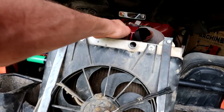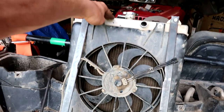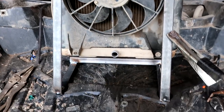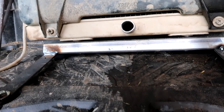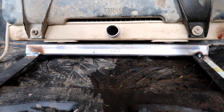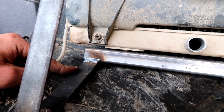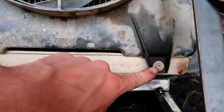This bracket right here is tacked up so it has a whole bunch of strength when you push it toward Jason — it's not going anywhere. But if you pull it back just a little bit, those two holes the original brackets are in start to pull up, which is no good. So I'm going to go from this portion of the frame and tie into this existing hole, and do the same on the other side.